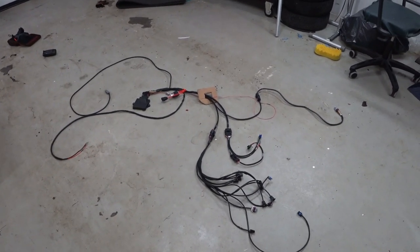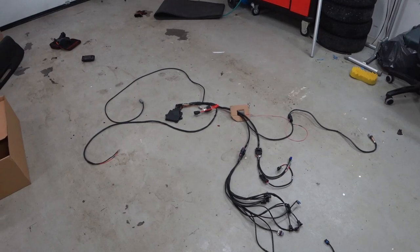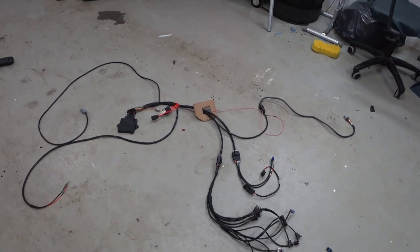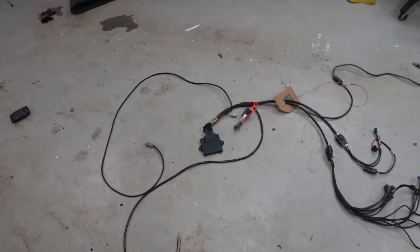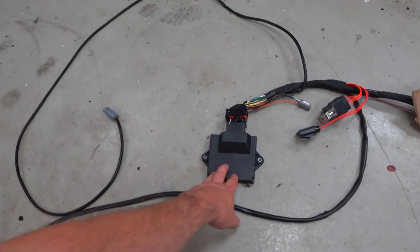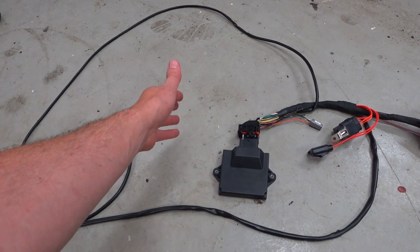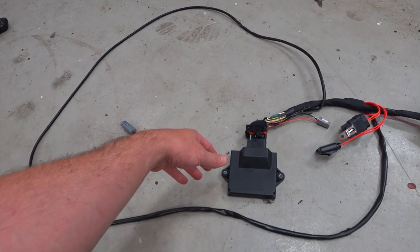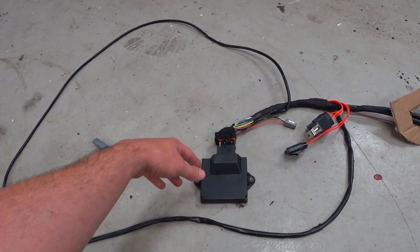One important step is to figure out how you will put in the wire harness in the car. So it's a good idea to place it on the floor and mock up everything, how long the cables are and if the length will be correct for your application. Also you have to decide where to put the ECU control. I have decided to have it inside the car since it's the best place to protect it from heat and vibrations and water and everything like that. And also it's the prettiest place to put it, because there's a lot of wires here.